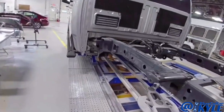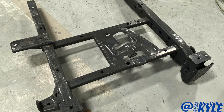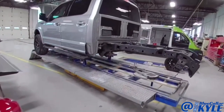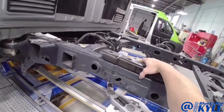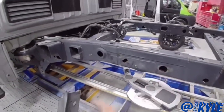This one's going to get a whole new back half of the frame replaced. It actually slides inside of the existing frame right here at this joint — slides in a couple inches. It also will get these new reinforcement plates welded on after I have the new piece welded in there.